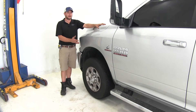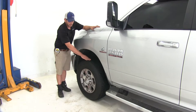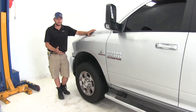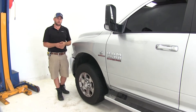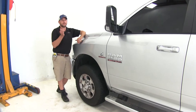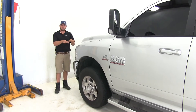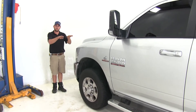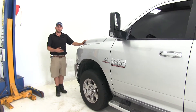With the front end lifting up about a half inch, it has several negative effects on our vehicle. We're not going to have as much weight pushing down on the front tires, so that's going to reduce our braking power and also our handling. By raising the truck up in the front end, it's also changed the geometry of the suspension, so the inside of the tires will probably wear out really quickly. Another side effect is that it increases the angle of your headlights — instead of pointing flat and straight down the road, they're going to be pointing upward, reducing visibility while driving.